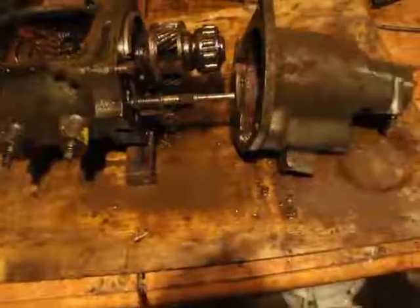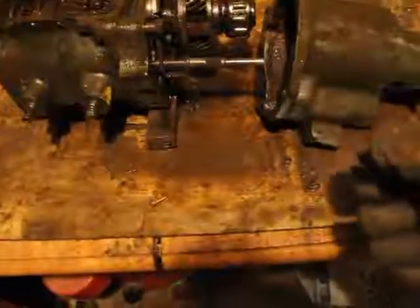It's a, what's the name of the damn thing? Punch. I think it's called a punch. Literally punch. So it's just a harder steel, but in my case, it just came out easily with the soft nail. I did use a set of pliers to hold the nail. And obviously, the shorter the nail, the better, because if you have a really long nail, it'll just bend once you hit it with the hammer. But if it's short, then it's stronger, right? I just used a set of vice grips to hold it. I cut the nail in half and put it in there, hammered it out.